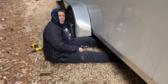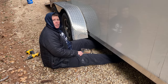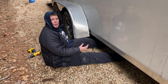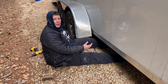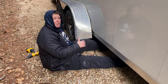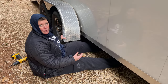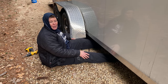One thing to keep in mind when you're towing a long trailer: you have to take your turns very wide. You might come across a situation where there's a huge landscaping boulder at the entry of a driveway. If you don't take that turn wide enough, that boulder can hit your fender and rip it off from the trailer frame — just something to be mindful of when towing a long trailer.